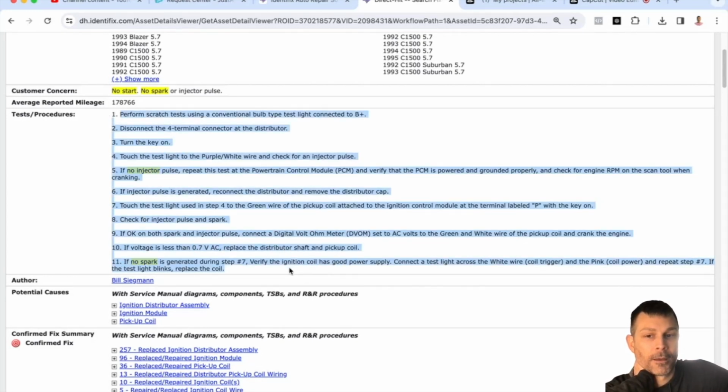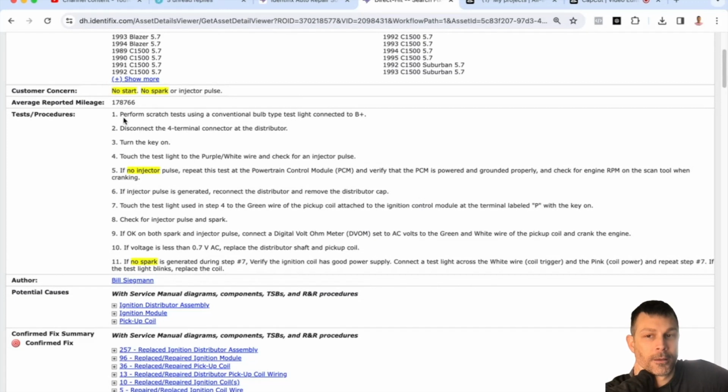Okay, so I'm going to check the ohms first is what I should be checking. No, the first thing you need to do is check for spark. It's got to have bright blue spark on all the cylinders while cranking it over. If it has spark, then we see if it runs on starting fluid. Just take a plug out, put a plug on it, and spin it over and see if it's going to spark. You just take a wire off a spark plug, use a spark tester or a screwdriver, and then watch for bright blue spark as an assistant cranks it over.